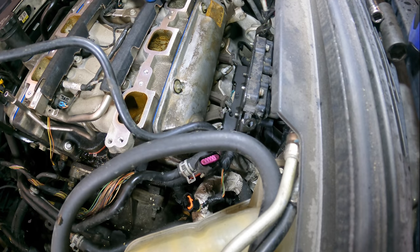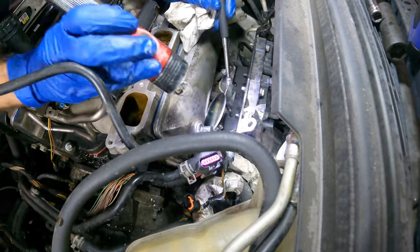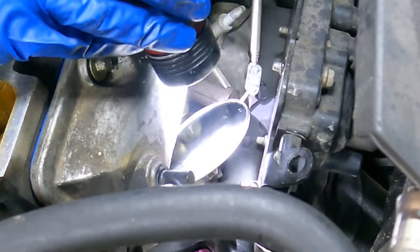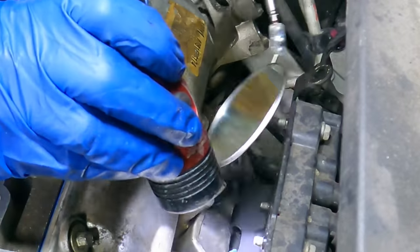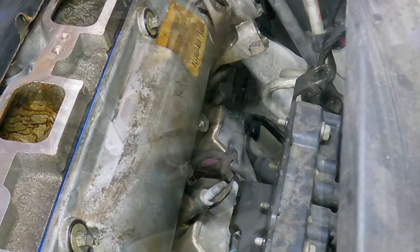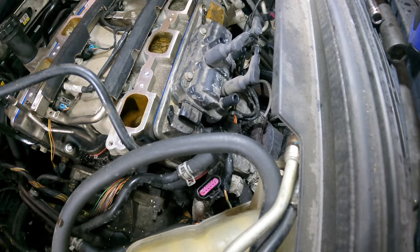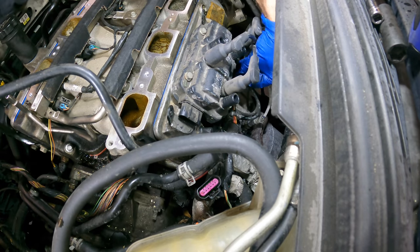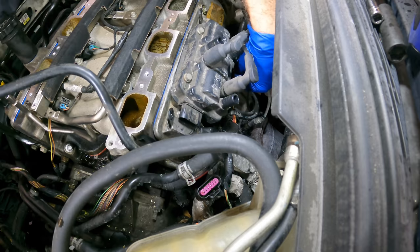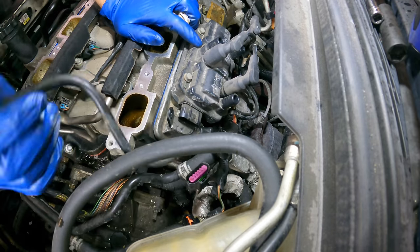Click. Now this one I'm going to check behind it with a mirror just to make sure that gasket stayed in place. Okay, let's see. I'm just looking for the blue, make sure it's not folded in or sticking out. Looks good. While we're in this area, I will go ahead and set this back into its position, and I'll start a couple of the nuts, not bolts, just to reduce my fastener pile here. I'll torque all of these once I'm ready to install the bolts up here at the top. But not right now, I can wait.